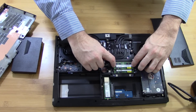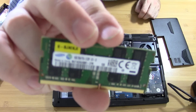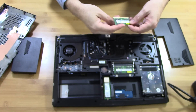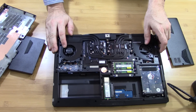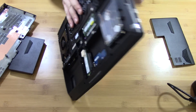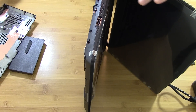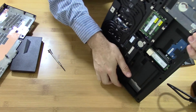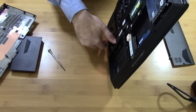Here's an interesting thing — the Samsung 16GB DDR4 modules, four of them. You can see two here. To get to the other two, it's a little tricky: there are two screws you need to remove. What you need to do is open up the laptop and, using a fine-tip Phillips screwdriver, push through the port right here where it says 'KB' — that will pop the keyboard out. Be gentle though.